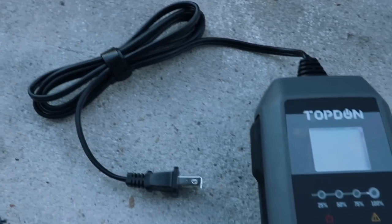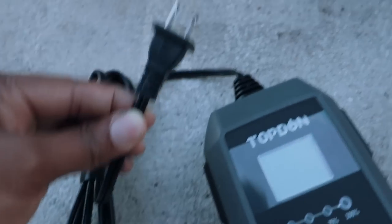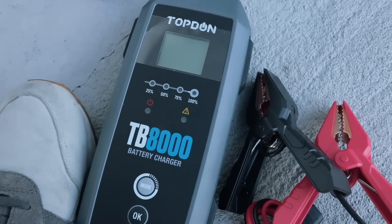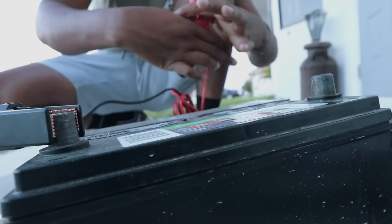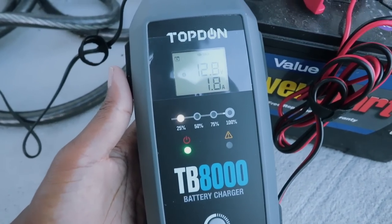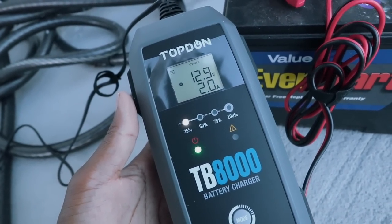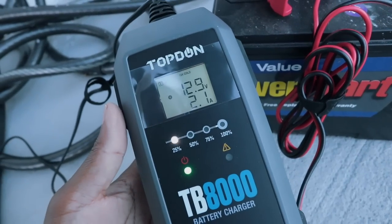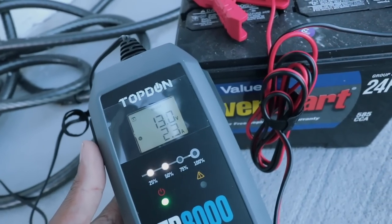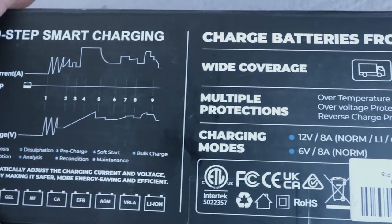Take it out of this case — here's the charger all laid out. Got the terminal plug going into your battery, plug this into your wall, plug that sucker in. Here I have this battery that never wants to start. We're going to plug up our TB8000 and see what it says. Negative, positive, terminals are connected — TopDon TB8000 is on. It's indicating flashing that 25% of battery life is on this thing; right now it's charging up. We have 12.9 volts at 2.2 amps and climbing — oh, 13 volts baby! God damn, that battery's charging up real quick.